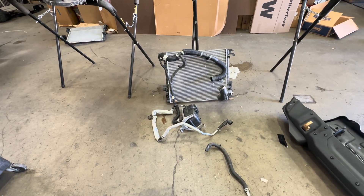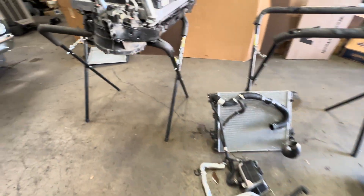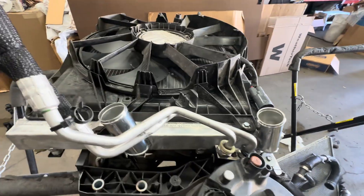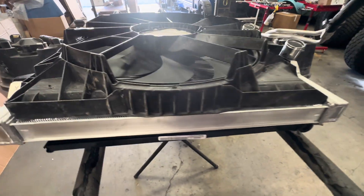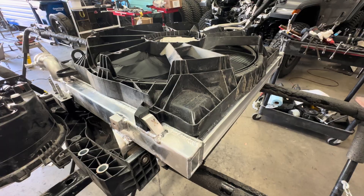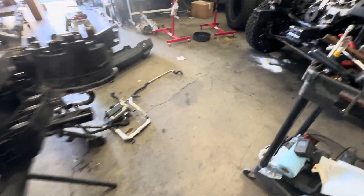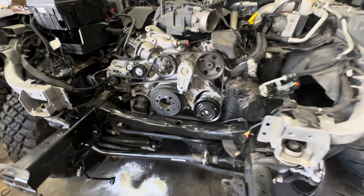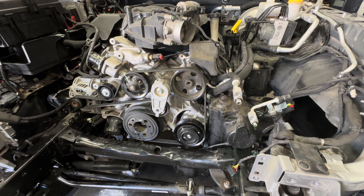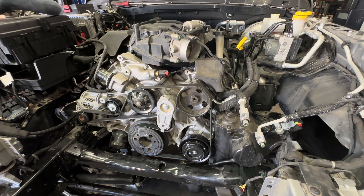It's all about cooling this time. I think I've touched on cooling before, but next will be transfer case stuff — I'm working on a video for that, getting everything gathered up. I think this is the right way to go for a radiator, and we will find out. We're using the stock fan from the 2-liter, which is the same fan for the 392 and the same fan for a 3.6 Gladiator — we've got them all here and tested them all. This thing's coming together. We'll be testing it more and more. Everything's been happy and it's been working good. I think we just have a few more things to keep working on, but that's why we have a guinea pig and that's why we keep testing. Jeep Speed Shop out.